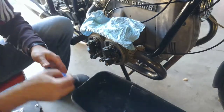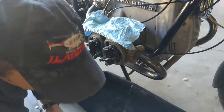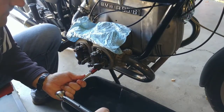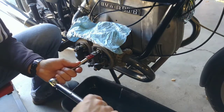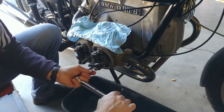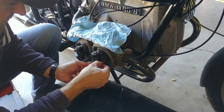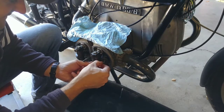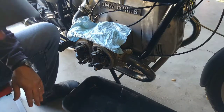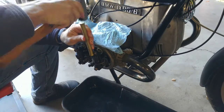And now we're probably gonna do valve adjustment right away. Since I hammer around on this, I usually go over it one more time in case anything decided to settle here. Oh, this one, I got a little bit of movement out of it. Nope. And that. And then I check one more time. Clear. And play again. Yeah, so it's not always perfect. It's not perfect right away. Gotta work on it slowly.